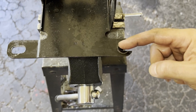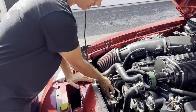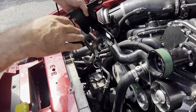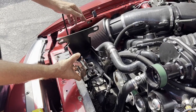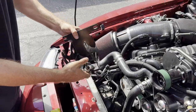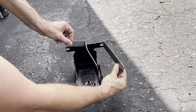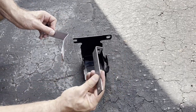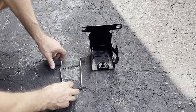This side was easy enough — I just took a grinder and slotted it right here, which allows the stud to move wherever it needs to go. This side I used a die grinder and just elongated that hole. We got our ABS module pushed over, but it actually required more movement than our slotting allowed — it needed to go even further. Because the fan motor is so big with the Mach 8 fan, we would have had to slot further, brace out, weld an extension — basically completely hack this bracket up. So instead we went ahead and made replacement brackets. These two replace the functionality of the original but they're at an angle which helps go with the angle we needed to tilt the ABS motor back, and also clears everything else out of the way. We made these out of steel, not aluminum, to make them stronger and more structural.